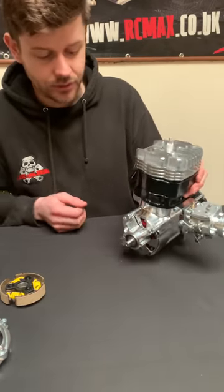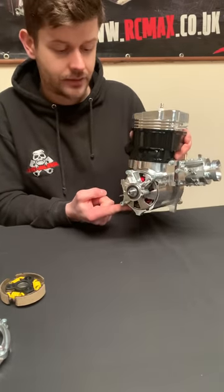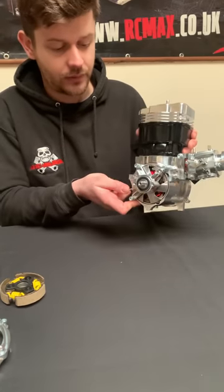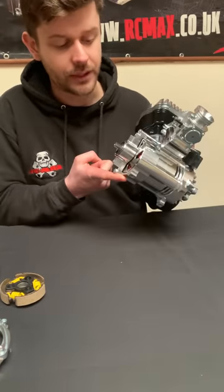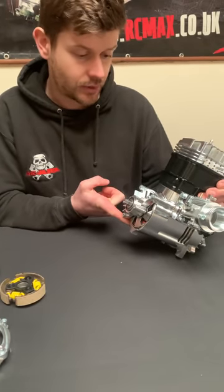If you're running 40 GTs, 50 GTs, 71 Supremes and want to go to the next level, you don't have to have any custom parts at all - just drop in and go. On the other side, we've managed to miss the fuel tank. We made the crank case quite thin; it just misses the rear brace and fuel tank. That's going to make it compatible with every hybrid kit on the market and every Baja out there. The carrier is inspired by the design of the 62mm and 54mm Baja carriers - I love that design with the cooling fins and lightweight three-leg design, so I've not changed it.